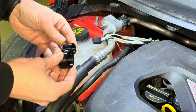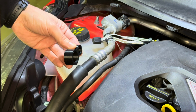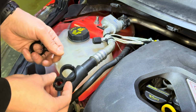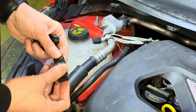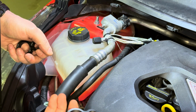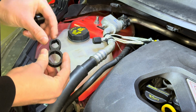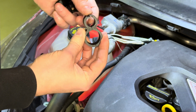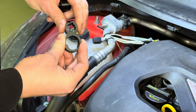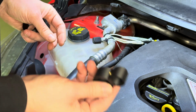Originally, when I was running the previous version of this bracket during the summer and also during the races that I'm doing, I utilized a different material. At first, I used ASA, which is some sort of an evolution of ABS. It has a heat resistance of up to 90 degrees Celsius, which did result in some bending, of course, and you can see it here, hopefully. It did result in bending in the water return hose part. It did hold up well, but this is not something that I want to keep in the car. It doesn't make any sense.